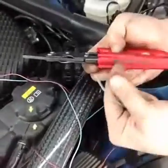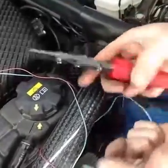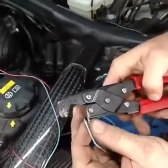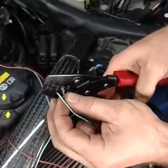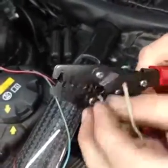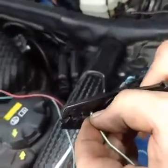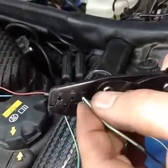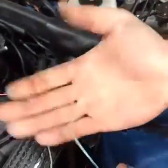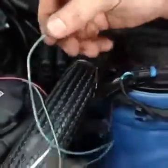Mac doesn't make these — they're just branded by them. I've used them for 10 to 20 years; they're fantastic and you can buy them for about 30 bucks. They have individual sizes and two different types of pliers. You crimp with these little rolls you see on there — you put the crimp in, give it a squeeze, and it rolls the connector into the wire for an awesome crimp.